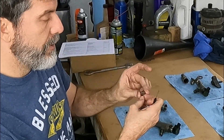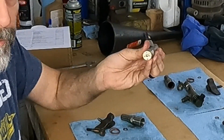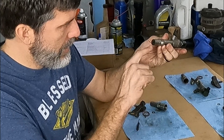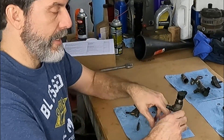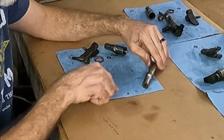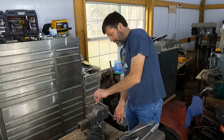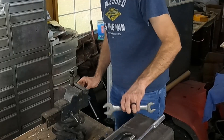This little plunger here should have come out with the spacer. Next, inside of the injector body there's a little spring — get that little spring out. And then there's a plunger, another plunger inside the injector body. I'm going to see if I can get that out without damaging it. This is a little spring cup — make sure you don't lose that. Next we're going to put it in the vise and get this electrical part off the top of the injector.